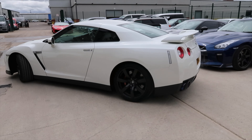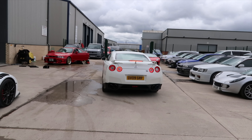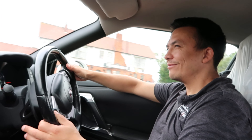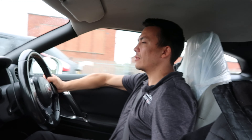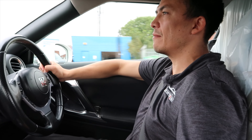Manny Juergen's going out in this R35 GT-R. So this one — we got it in the other day, it has an ABS fault. The traction lights and ABS lights would come on. It's quite common on the early GTRs where the ABS units fail. We just take them out, send them off to get refurbished, bring them back, bleed all the brakes, fit them — problem solved.